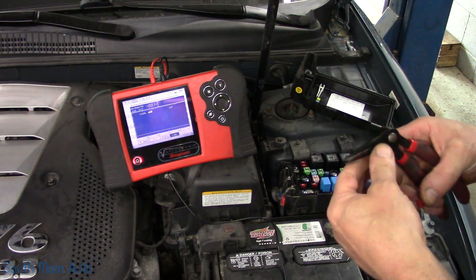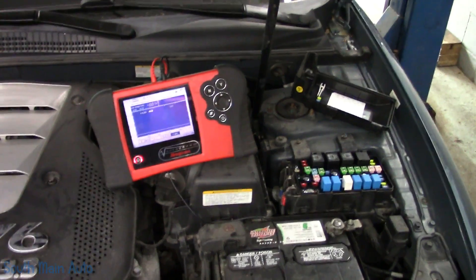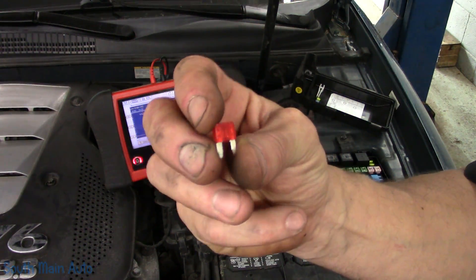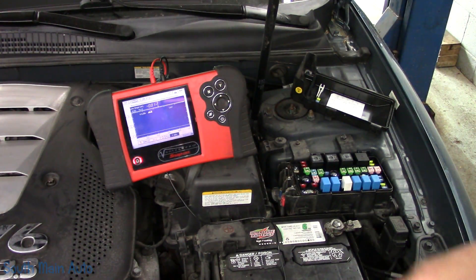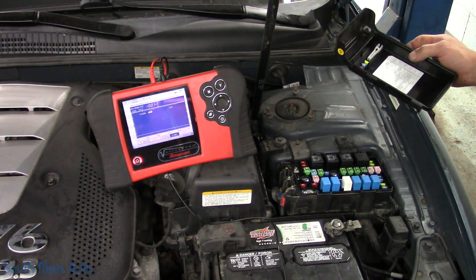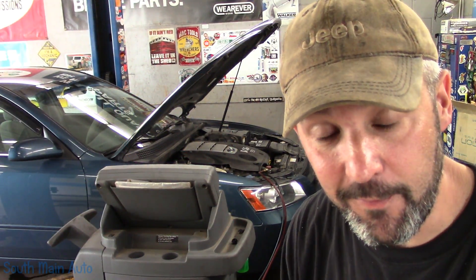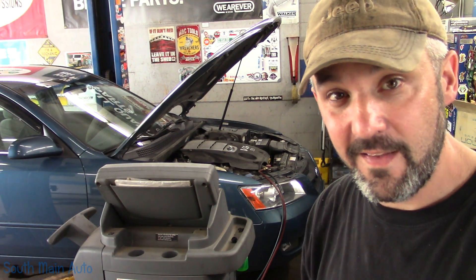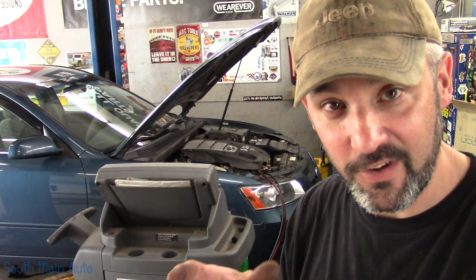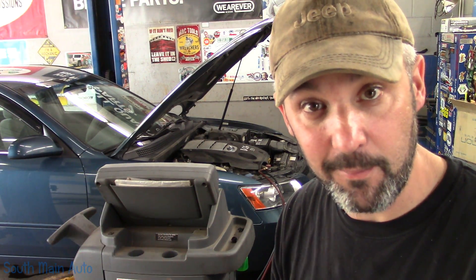I've got another fuse and I'll stick it in. I'm happy making the call on the compressor. It failed exactly how I suspected. It held pretty steady around 13 amps before it finally opened our 10-amp fuse — but these are Littelfuse fuses, not Dollar Tree fuses. It took about 14 amps to open it. I'm making the call — it's going to need a compressor. We got the green light from the customer. Technically it's the field coil, but I can get a new OEM compressor for almost the same price as just the field coil. 11-year-old car, 11-year-old compressor, all original. The customer opted for the whole compressor assembly — comes with a new clutch coil, everything.